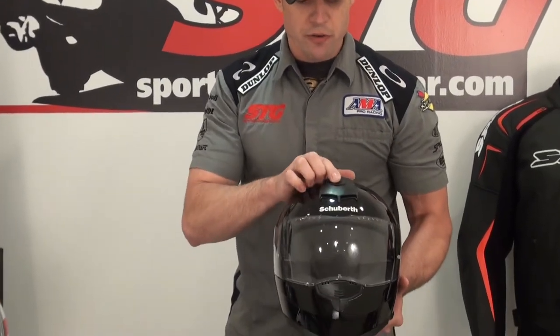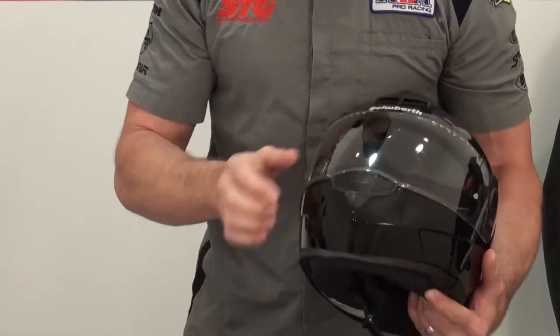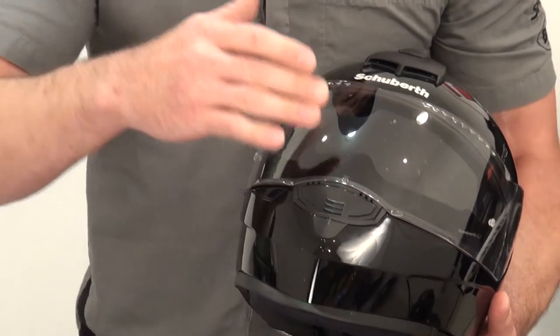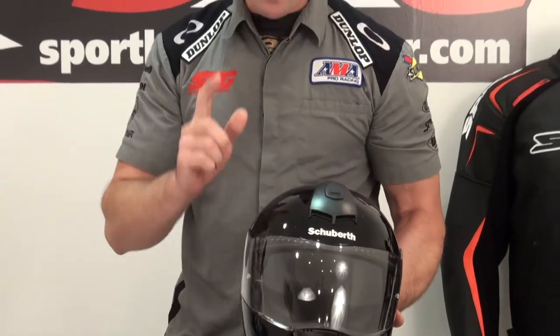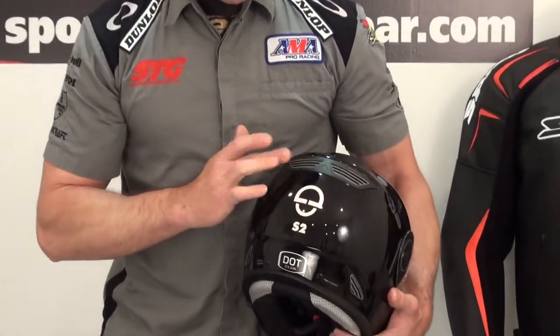Airflow — sneaky good airflow. With a high airflow helmet, you're used to all this wind noise rushing in. They've done a lot on this helmet — we'll show you more in a second video when I totally disassemble it. They've done a lot of things to ensure it'll be as quiet as possible even with that airflow. This helmet exchanges 2.7 gallons of air a second when you're riding — that is a ton of airflow. They do that with a combination of a multi-position vent on top and a vent at the chin, which primarily brings air up onto the shield and helps circulate it around inside.